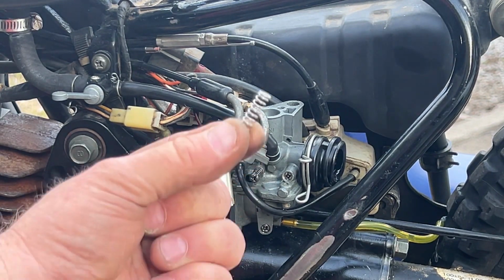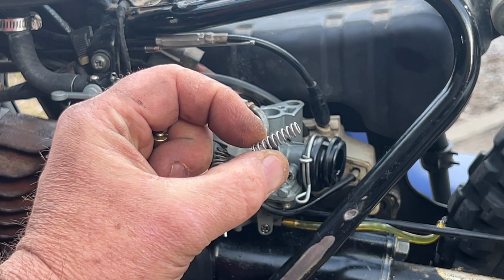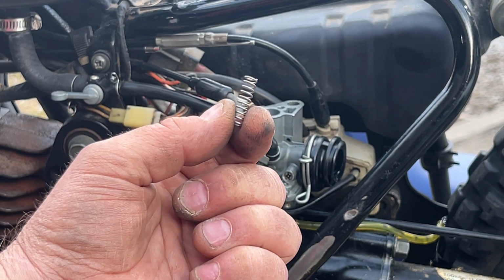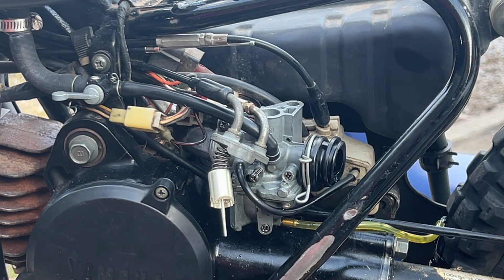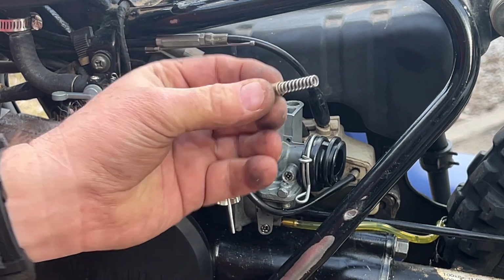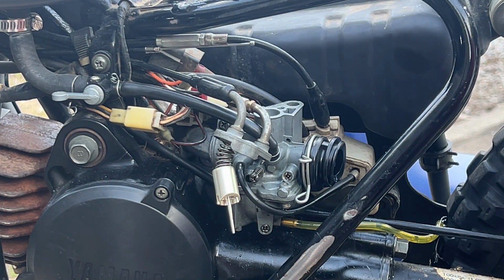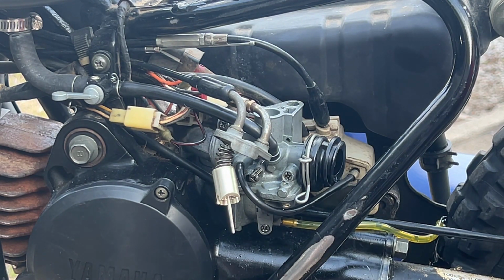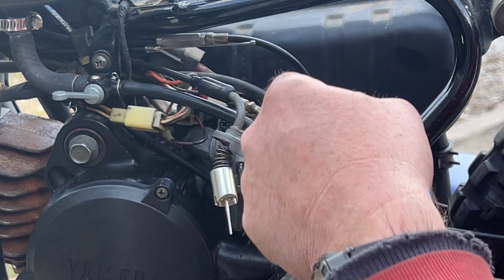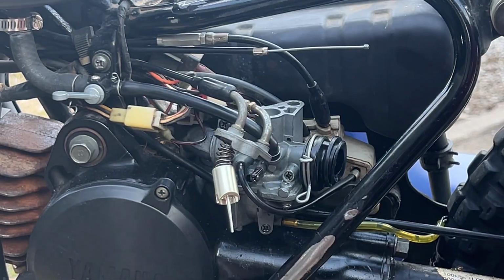I can't tell you how many times this little spring kit has saved my life. Dead on the same length and within 1/4 millimeter in diameter. This one's a tiniest bit smaller, but it does fit over top of the plunger for the choke. Well, we are getting oily dripping back here. Where's that coming from? Worry about that later. Where's that choke cable? Okay, pull this sucker through.